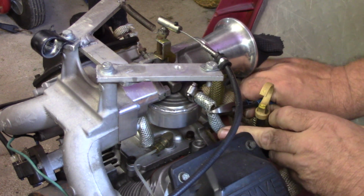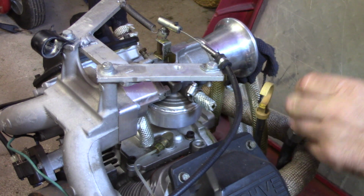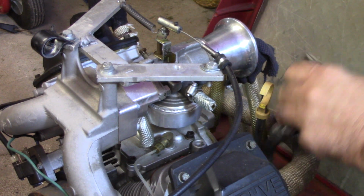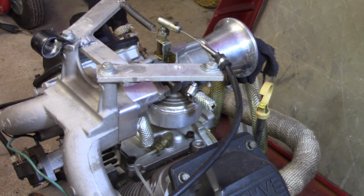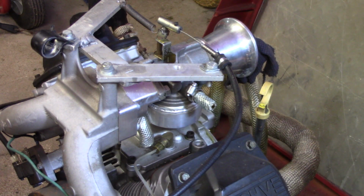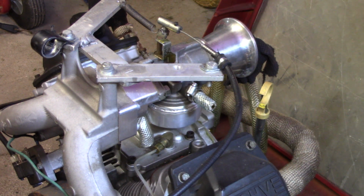And then we're also going to pull the bowl on this. May end up pulling the whole carburetor off and going through it again just to make sure we ain't got something going on on the inside there. But there's that off there. Throw that up in there. Got me an old empty oil jug here, and I'll mark that it's got methanol in it. But even smelling this stuff, it doesn't even smell like good methanol.